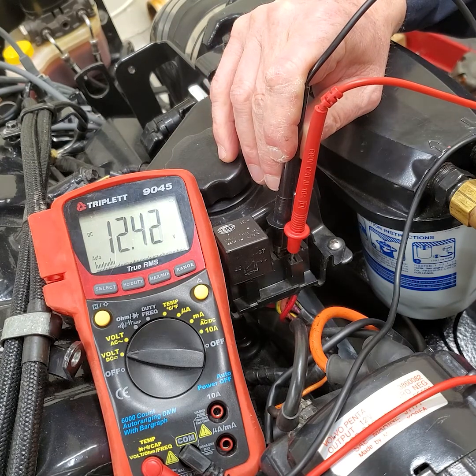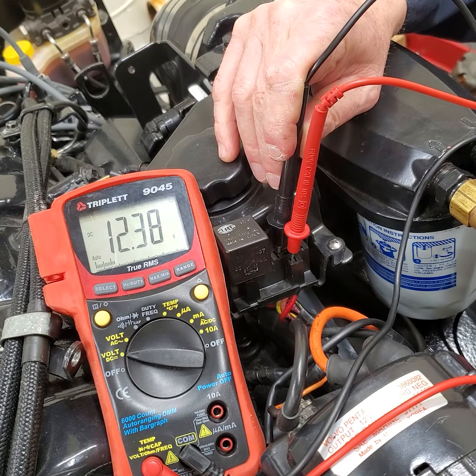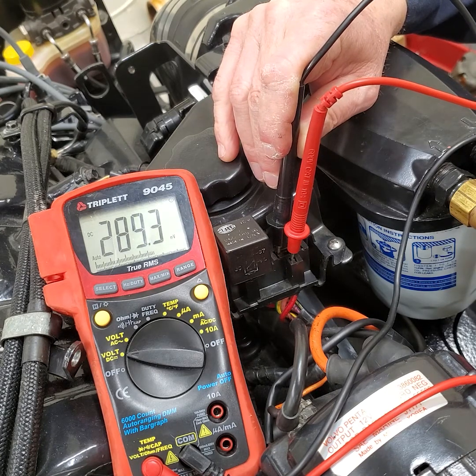And it is — you can see that the circuit from the ECM is grounding the relay pulling coil. So we know the relay is not the problem and we know the pulling coil is not the problem.